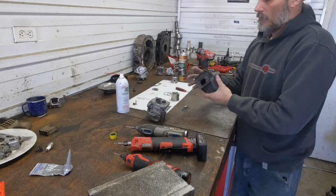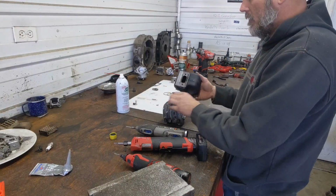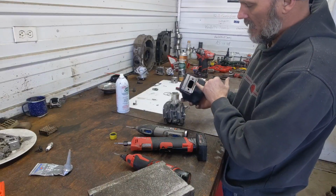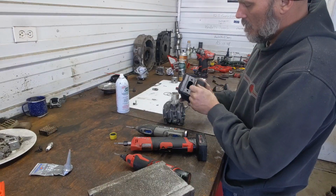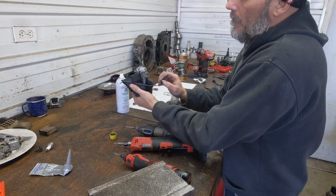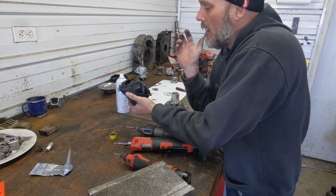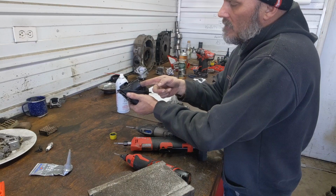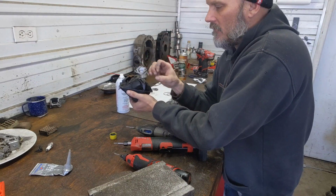Muffler. So you'll have to take this off and then you'll put it on your cylinder here so you can case match or exhaust match this exhaust gasket, and then I put it back on the cylinder and I just match the gasket itself. So that's how you match that. The exhaust on these is completely hollow. I don't have a screen requirement here in Iowa, so the screen is out of here. This is stock. I like to put a hole in the side, and I like a deflector. I've never really been a fan of the pipes.